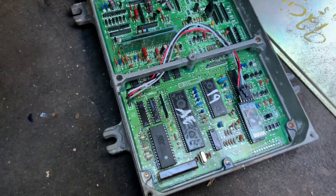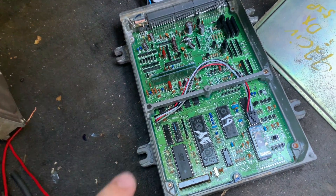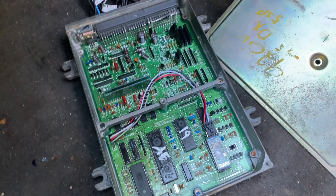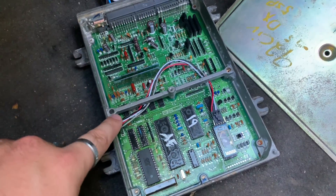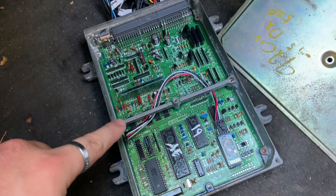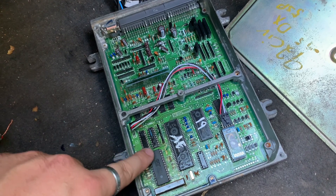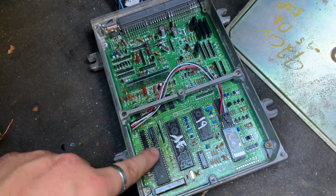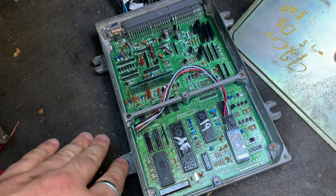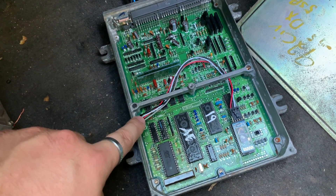So here's the inside of this, and this is from Facetune — the guy I got the ECU from for the Acura. I've been putting his link in the description of all these videos. So this is the data logging pin set here. There are four pins that come up, and those are not on the ECU from the factory — those have to be added. Same thing as the socketed ECU, you've got to put the socket in. When you chip an ECU, all of those get added at the same time. If you buy a chipped ECU, they should be there. If you chip one yourself, you're going to have to add this.